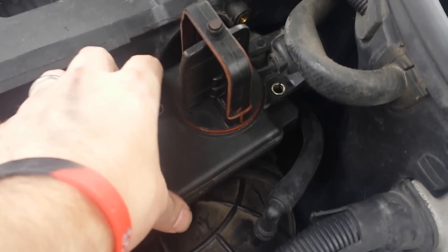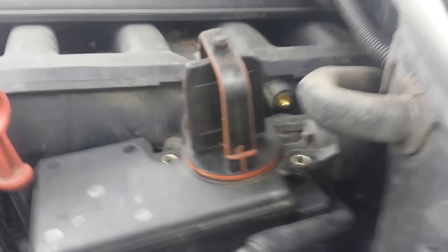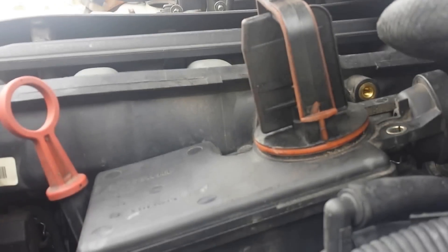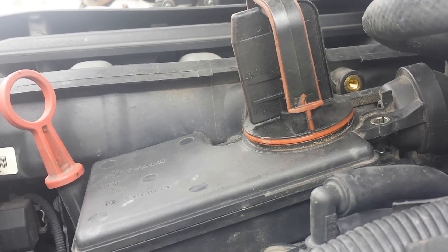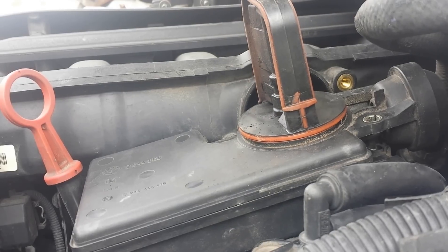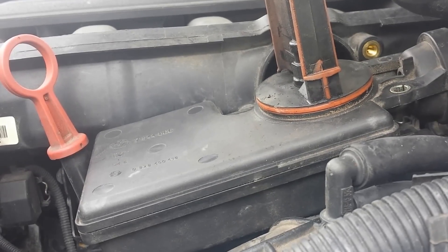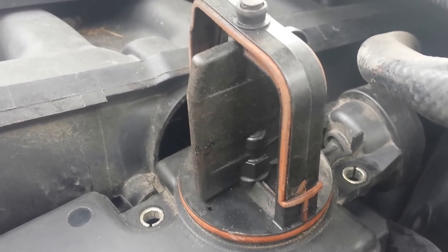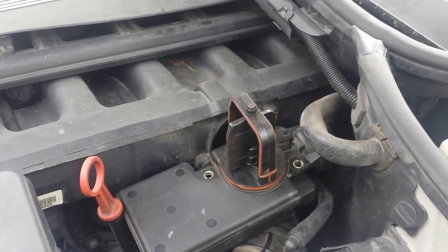But that didn't confirm that the little motor that makes the vacuum was still good. I just wanted to point out that you can test that quite easily without damaging your car at all. If you just turn the ignition to the run position without actually starting the car, it sends the signal, turns that on, and as you can hear from the little buzzing, it keeps running shortly after — and that way you can check to see if your valve is good.